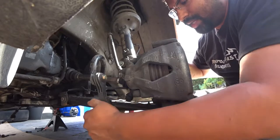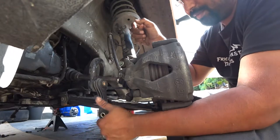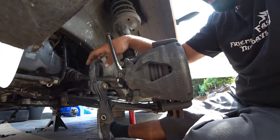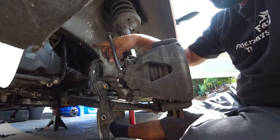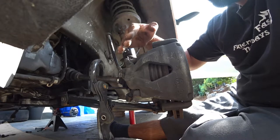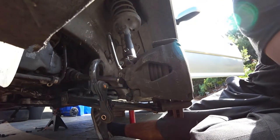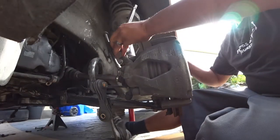As long as both sides of the car are off the ground, the sway bar end link won't be under any tension. If one side is up and the other isn't, it'll be really difficult to take off. We're not going to reuse the sway bar because on these cars it gets in the way when you put it on bags — it'll stop it from going all the way down to the frame. We'll frame notch the car in a future episode, but for now we're just doing the bag install.